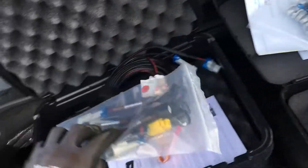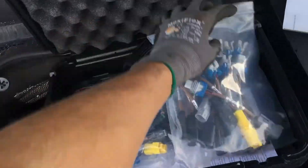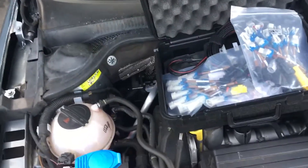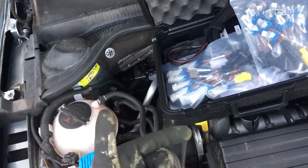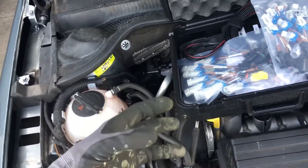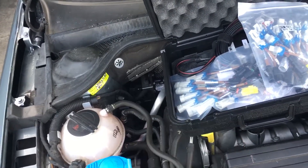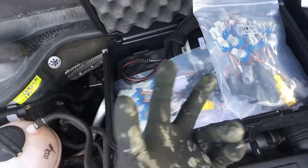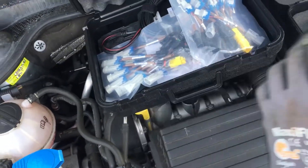They said it was just low on charge and that's why it wasn't working. I don't think so, because I actually did the charge twice and I weigh my container before it goes on the scale, then re-weigh my tank after disconnecting to make sure the before and after weights match the charged amount. I do a triple redundancy on scaling, and I did the whole procedure twice.